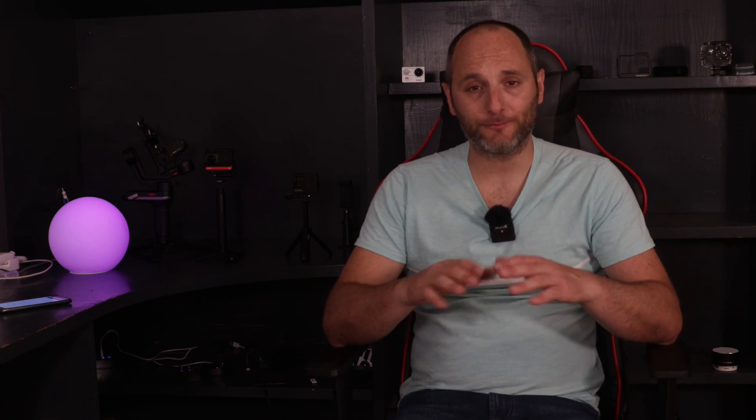The scooter weighs 22 kg and can support a maximum of up to 120 kg. But it must be mentioned that if you have 110 kg of weight and you have to face inclines of more than 10 degrees, you will struggle with this scooter. Based on the test I have done, the motor running at limited 25 km/h has delivered 465 watts. Obviously on this parameter there is also the weight of the driver to calculate.